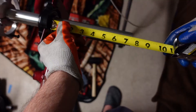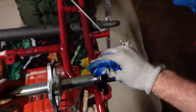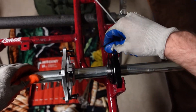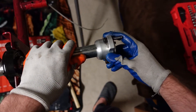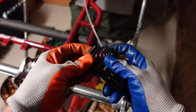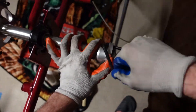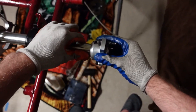Now measuring the output of the axle on each side, making sure I'm as even as possible. Then tightening up the grub screws on the rear axle so it doesn't shift inside — nice and tight. Putting on the rear wheel hubs now — nice and smooth, nice and clean. I put the track width as wide as possible and full caster in because this cart has no grip.